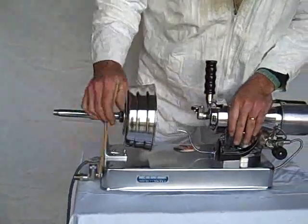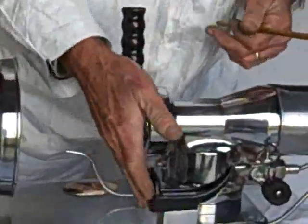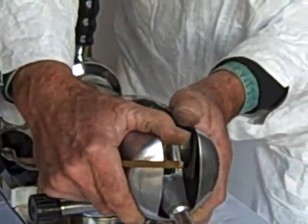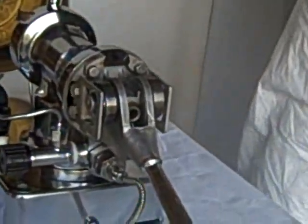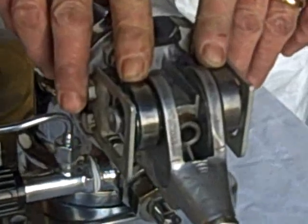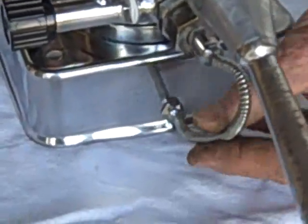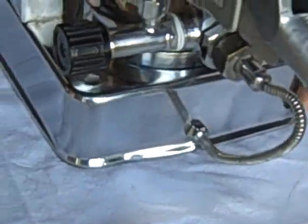On this side we'll see the steam wand again. We'll turn it up this way so you can get a look. I've loosened the screws on the aluminum cover. As you can see, it has two big bearings, which gives you a nice smooth pull. Got some fresh grease in the bearings. This part here is the cover for the thermal probe that sits down into the group and monitors the temperature.